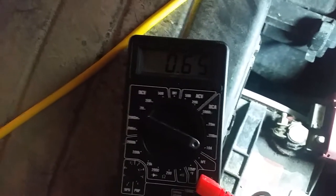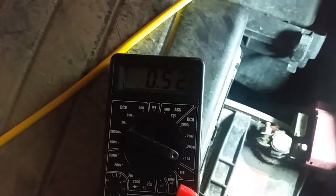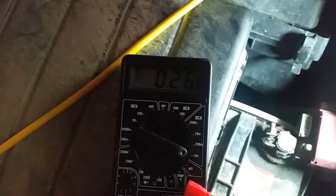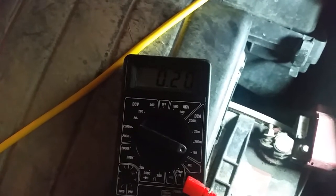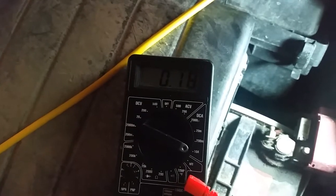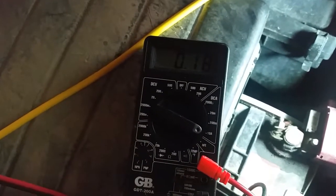It's gonna start a little higher because it's charging the internal capacitors in the car. Right now it's reading 600 milliamps — 0.6 of an amp — and now it's dropping to 0.3, about 300 milliamps. What we're looking for is 0.05 amps or less — it should be less than 50 milliamps when the car isn't running. We're currently sitting at about 180 milliamps, which is a little bit high, so we have a draw on the battery and we're gonna try to figure out what's causing it.